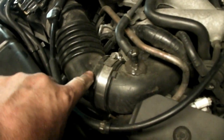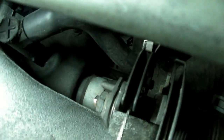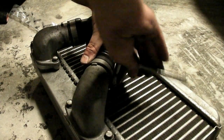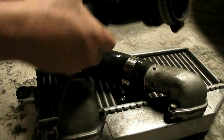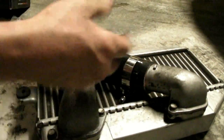Here's your filter box — it travels down, you've got your mass air flow sensor there, travels down and connects to the inlet side of the turbo. The blow-off valve goes into this tube right here, so you have to get a clamp off right down there. Silicone hoses are much easier to work with than the factory hard plastic stuff — the factory hose is really rigid with just a little flex joint in it, very rigid compared to these silicone hoses.